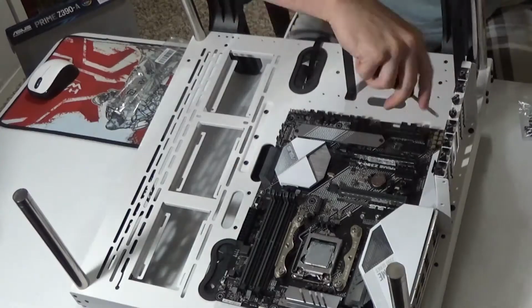In the event that you don't have something like that and you wanna still build, touch something that's metal and grounded before you touch the computer. All of these components are so touchy that if you present some kind of static shock, you risk destroying some kind of diode or some kind of device within each component, and it's useless. It becomes a brick at that point, essentially. So avoid static discharge onto any computer components when you are building computers.